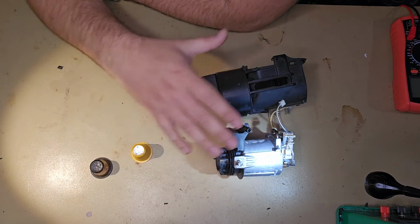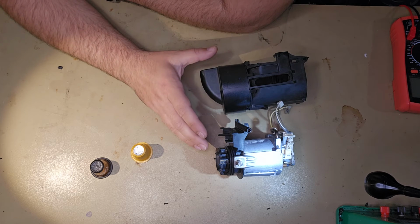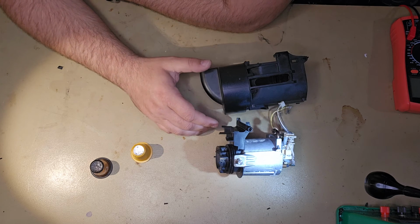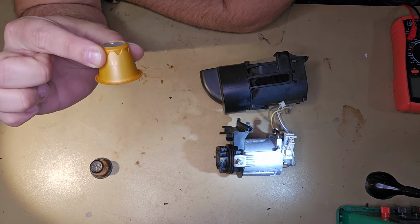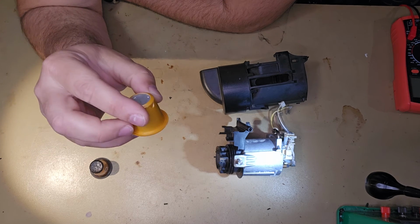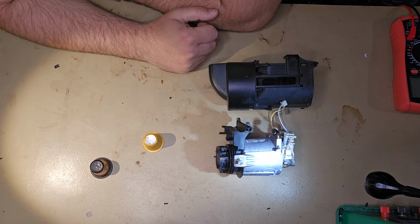So again, on this channel I repair and show you how to repair a lot of coffee machines, but on the Nespresso ones I think I have the most comments. Okay, I did this and I changed that O-ring, I overhauled, I did the descaling, I still have leakage. And this is why, because you are using alternative, different supplier pods, and they don't have this sealant. So yeah, I hope I did answer some questions.